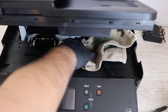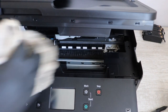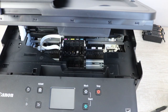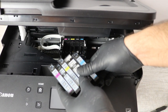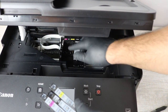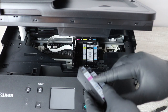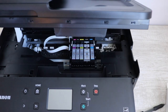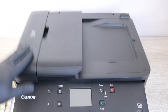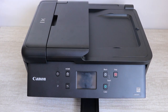So you're going to remove that paper towel — it is soiled, it's finished, throw that away. Then you're going to want to grab your rag and dry everything up. You don't want there to be any leftover cleaning solution. Clean that print head up really well, then you're going to reinstall. Hopefully these are a fresh set of cartridges you've purchased — link in the description below for some more affordable versions of this ink. From now on, make sure you keep up with the ink. Check it yourself; don't trust the printer tool that shows you the ink level, because this is going to cause issues again if you don't stay on top of it.